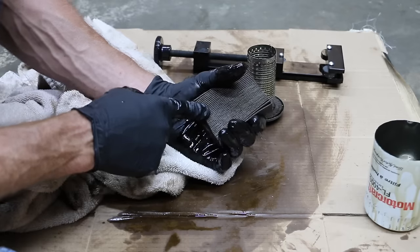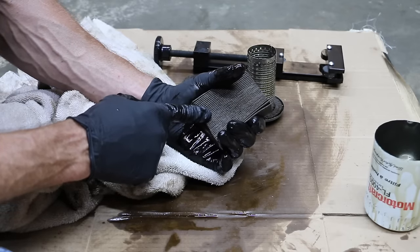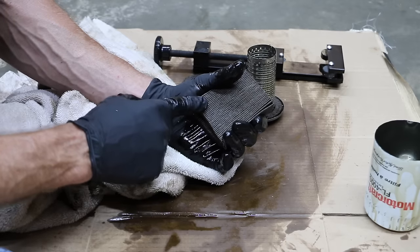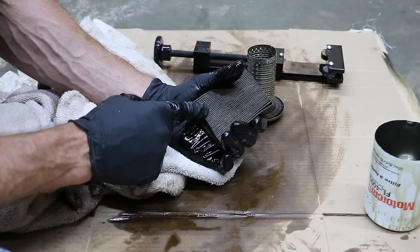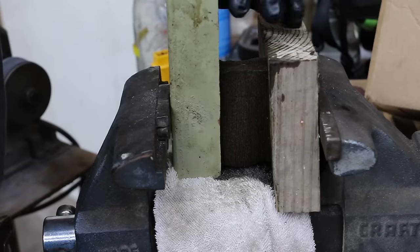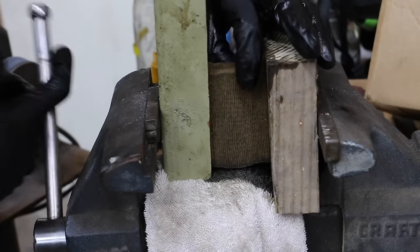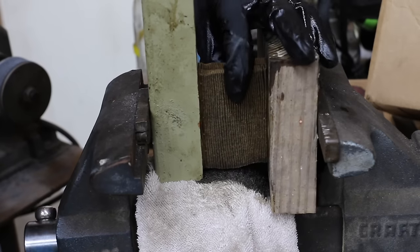It's very hard to look at these filters while there's oil in them. I got a great tip from someone who suggested placing the filter in a vise and applying some pressure, which removes most of the oil, allowing us to take a much closer look. I'm going to take this filter out and look at it — notice how much lighter in color it is because the oil has been removed.